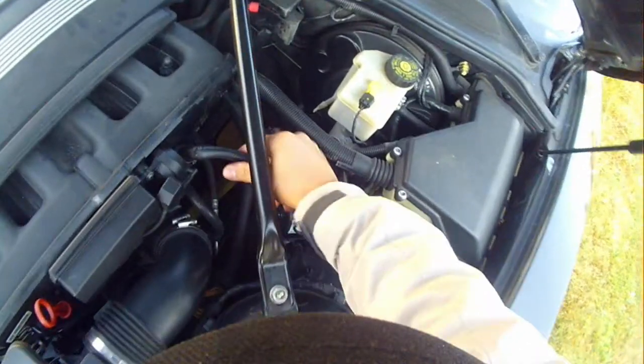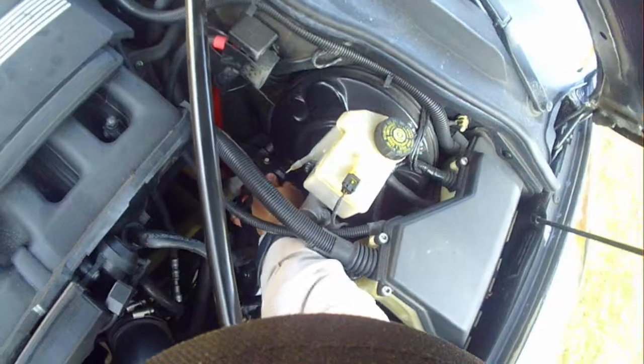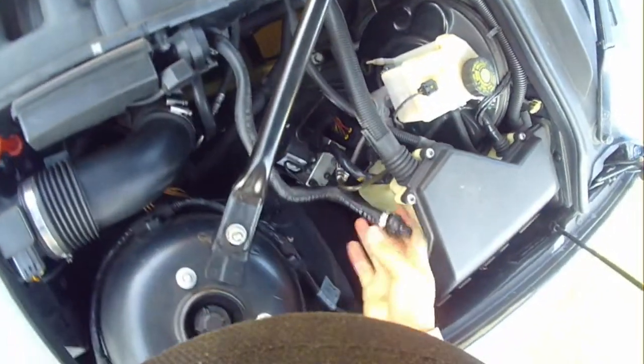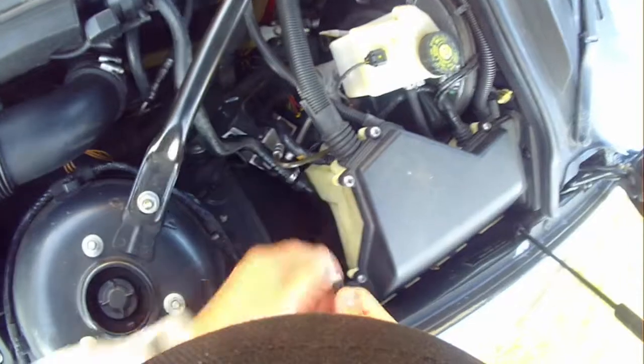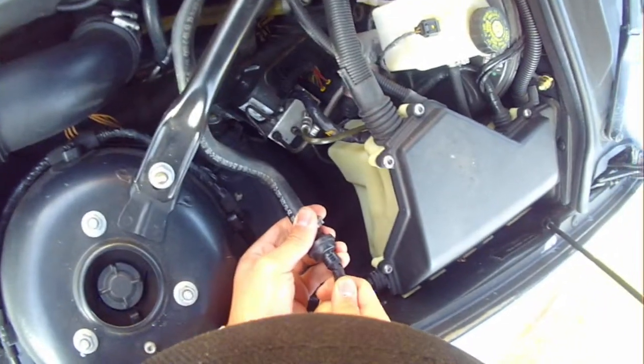So make sure that your car is at operating temperature. And what you want to do is remove the brake booster line. That's the easiest hose to locate, and obviously it's for the brake booster. Now this fitting I have was for a Scion TC that I fabricated for, and obviously the brake booster line is a lot bigger on this one, so I didn't need that.